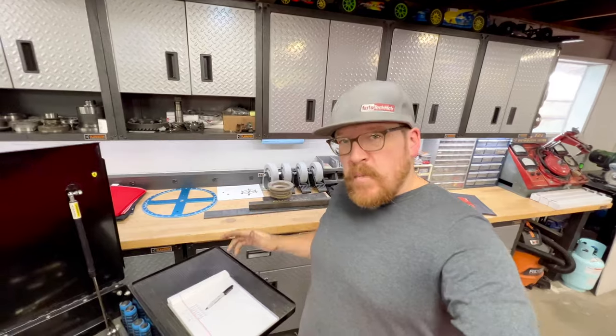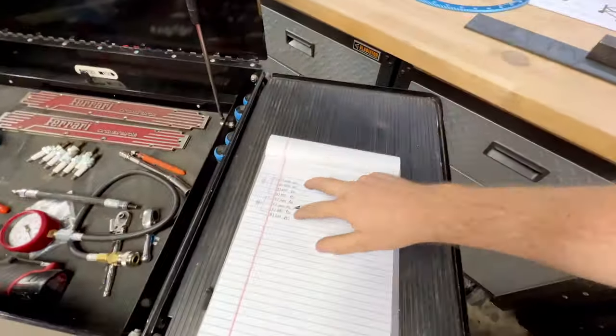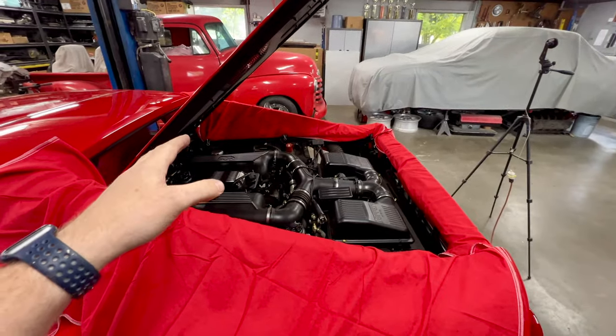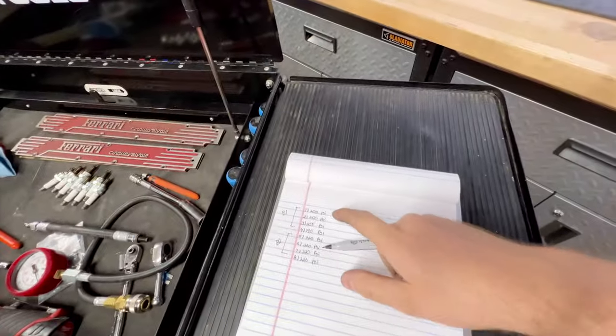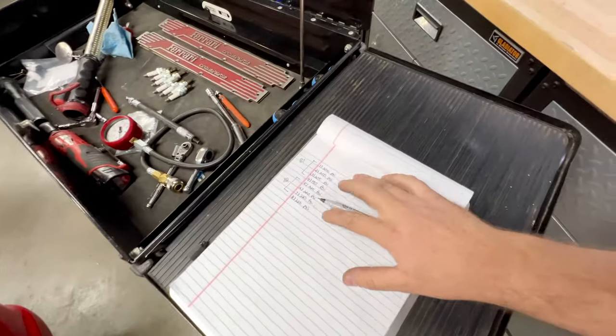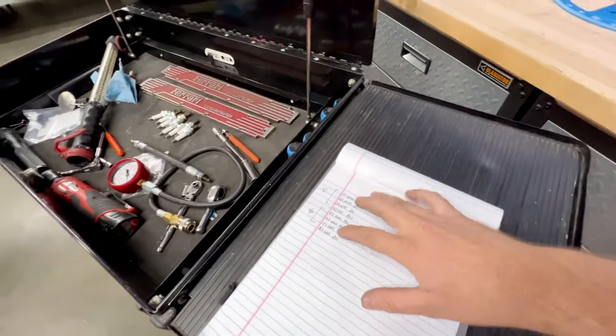The reason why I'm not worried about that spread bank to bank all comes down to our camshaft timing. We will verify when we take this engine out and get to the timing belts, before we remove them, that they are timed equally bank to bank. I'm suspecting that there's probably a bit of a variance from bank 1 to bank 2 on the camshaft timing and where they're degreed in, which is changing our valve events, which is the reason why we have this spread in our compression.